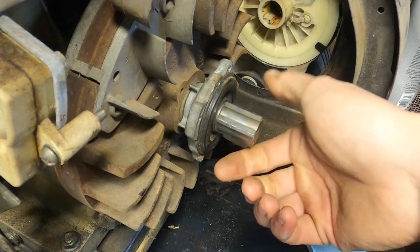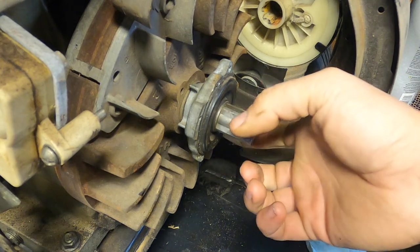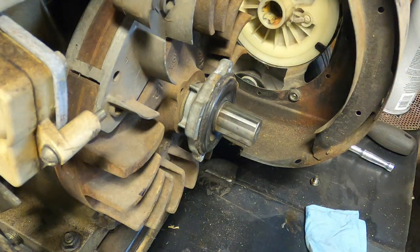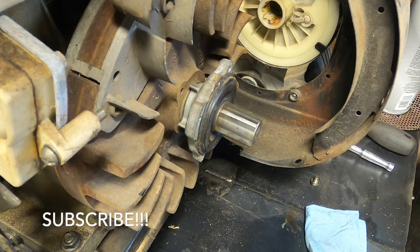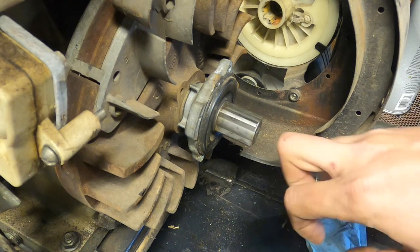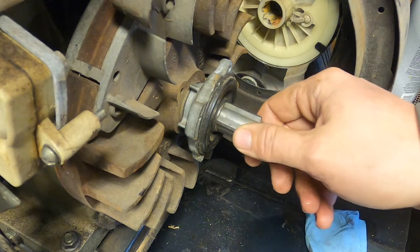Now that sounds pretty nice — it locks up very nicely. You just serviced the clutch. I would prefer to put ATF in there, but you do not want to put anything heavy — heavy is just going to cause a squeal and potentially break it. Light oil is what you want. If you don't have any, go get some. If you're in a complete bind you can run it without oil, but I wouldn't do it for too long. There is also a little felt pad underneath the metal section — I looked at it and it seemed a little oily already so I didn't worry too much about it.